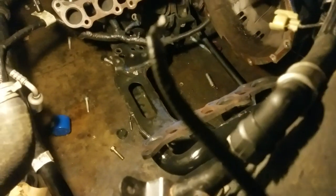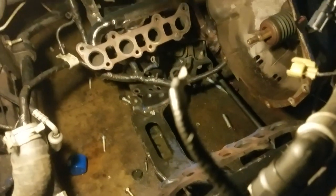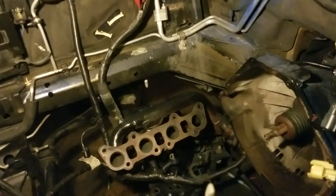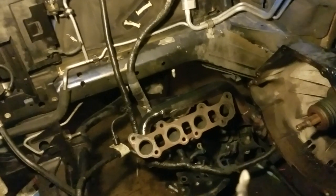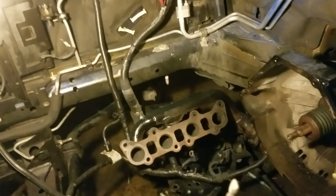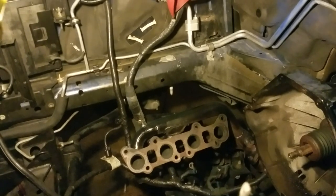With the k-frame dangling down, I had to make sure everything was straight and there were no leaks. I did notice a little bit of oil leak at the oil pan base and at the crankshaft area. On these coyote motors, when you take off the crankshaft pulley, there's sealant that goes in the keyhole and around the end of the crankshaft when you put the pulley back on.